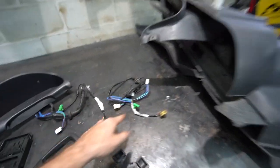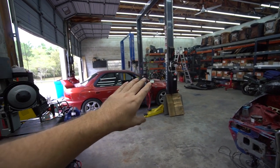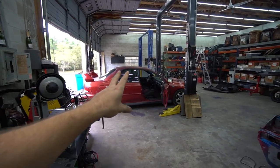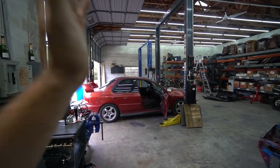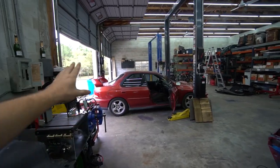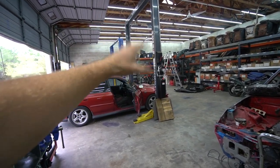One of the big things is rear door harnesses. So I bought this car with the swap already done, and what they had done is taken the WRX harness and put it throughout the entire car. So the whole car had a WRX chassis harness. The cluster didn't, it was a mess. Like half the stuff didn't work. So I got a GC chassis harness, sent it out to iWire, had them do a merge service on it. So it's basically the entire GC normal chassis harness throughout the car, and then it just converts it to work with the engine harness of the WRX, right?